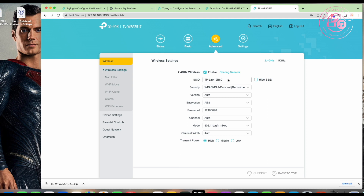At the moment my main network is broadcasting as 'SMJ Media Group' and the extender is broadcasting as 'TP-Link' with its number — so that creates two separate Wi-Fi networks, meaning two profiles on your phone. Every time you move around the house there's a delay switching between them. The easy solution is to put them all on one SSID and one profile.